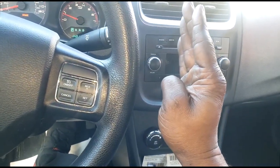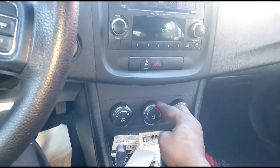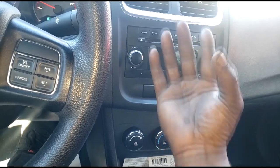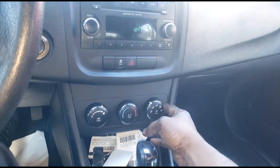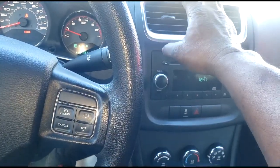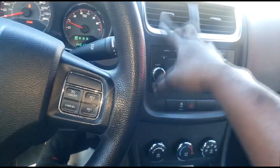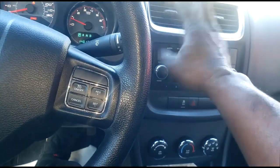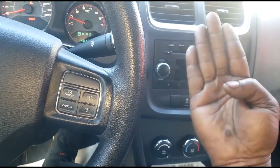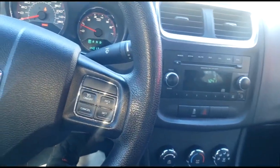That's when you come inside to verify if it's a distribution problem. Every AC unit has what we call a blend door. The blend door moves based on input from the driver. If I put this in full hot, that door should be fully open for heat, which allows hot air to come out of the vents. Right now I've got it on face vent — I should be getting extremely hot heat. In full cold, the blend door should go full cold. If it's not following instructions, you could have a distribution problem — a faulty blend door actuator or blend door itself.